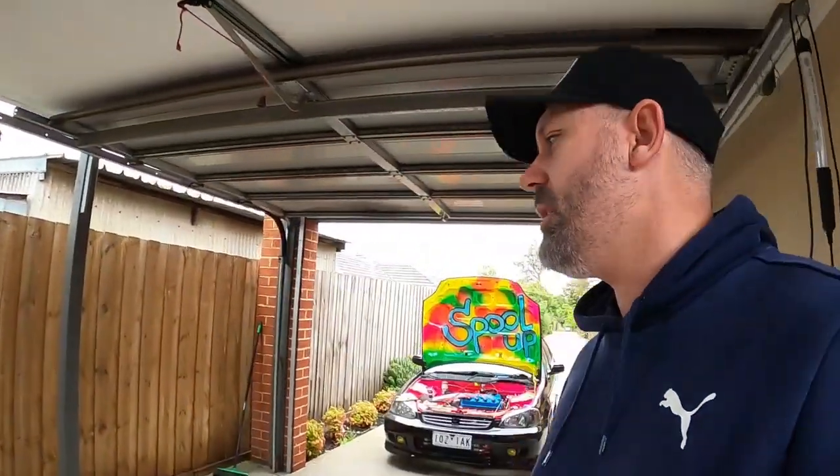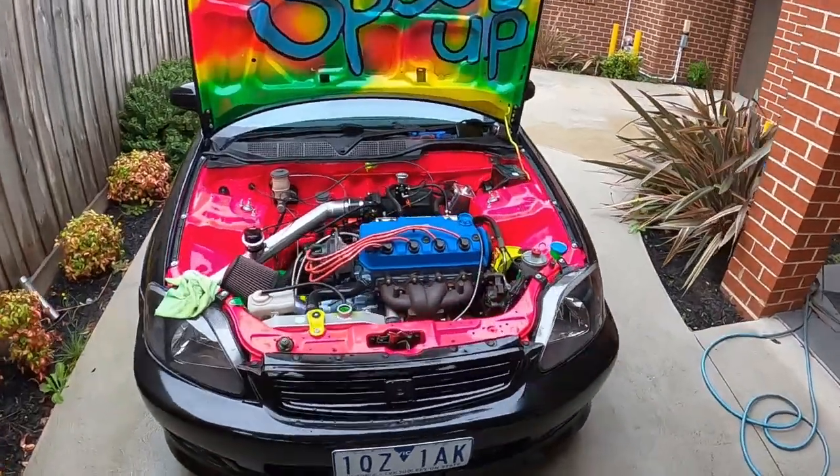While the engine was warming up I decided I'd check the oil catch can, and I freaked myself out - I thought I had a blown head gasket because when I emptied it, it was milky and white. Then I checked the oil. I looked inside the rocker cover expecting the worst, but then I remembered my compression was all even across all four cylinders. The car drives fine, the dipstick was clean, inside the rocker cover was clean, and under the oil cap - clean. We'll see how we go - we might still have a blown head gasket, but let's take a look.